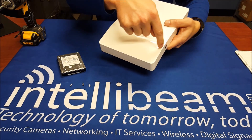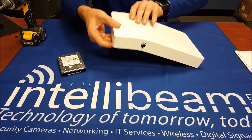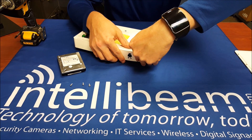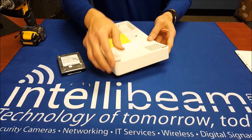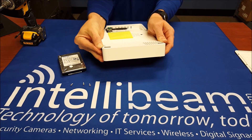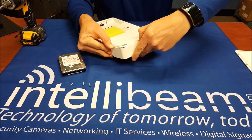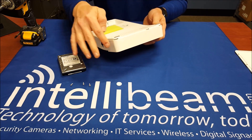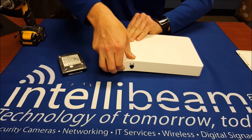You'll see that the TiVo gets separated by the strip right here. The hard drive is actually underneath here, so we'll go ahead and take this off next. Basically just flip it over and pry up underneath one of the corners just a little. You'll hear it snap off, and then as soon as you hear the snap, flip over to the other corner. Try not to lock it back on again. After you get all the corners off, don't keep prying because there are clips on the other side that have to come straight up — once you get the corners, you're basically just lifting it off.